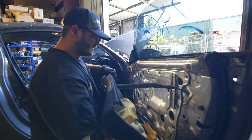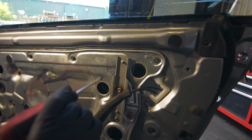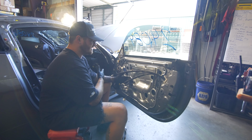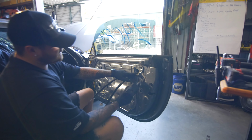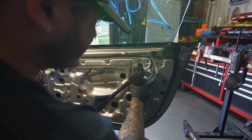We've got the door panel off, the handle off, the window switch off. You don't need to take the tweeter off or the mirror off, so just kind of disregard that section. Make sure that the window is all the way up. And then it looks like this window's been replaced before. The reason I can tell is because normally there's a black sticker that goes over this one and that one. That black sticker, basically they try to keep it so that no dust can go inside the door or come inside the car. So there's stickers over all these little pieces right here. Somebody had removed those already. But if yours was there, you would have one here and here and there and there and here and there. Anyways, we'll get to this one right here.